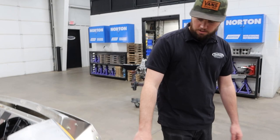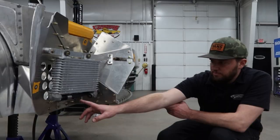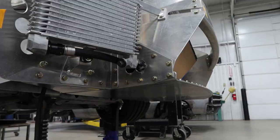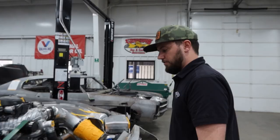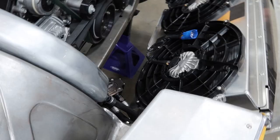We keep a pretty good selection at the shop specifically for this purpose. We do a lot of preliminary routing. It's got the remote oil filter mount inside the engine bay, so working on getting the cooler hoses to that oil filter mount. You've just got to make sure you have all your passageways and line clamps and routing at least 75% finalized in fab — that way you have room to account for everything. For the remote oil filter mount, we use quite a bit of the Improved Racing stuff, especially the filter adapters. They make a pretty nice product.